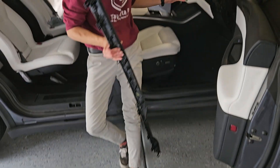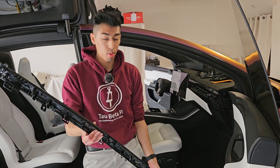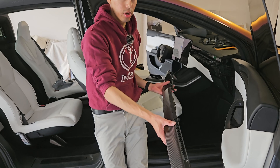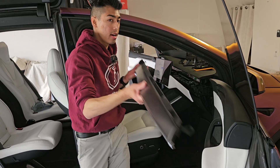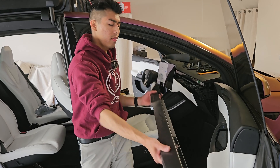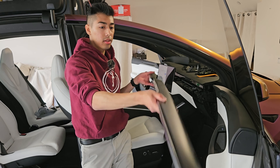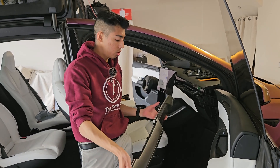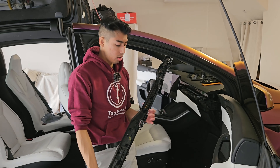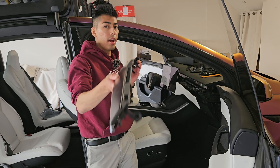It's easiest to kind of rotate this screen so you have a little bit of mobility when pulling this up from each side. When pulling it out, pull it towards the car at an angle — kind of pulling it up towards the roof but also at yourself. You don't want to pull it straight up; you might for the first initial set of front clips, but afterwards you'll break the longer clips in the back. So pull it up and out, then remove it towards you and out.